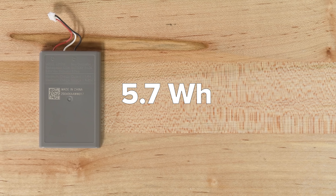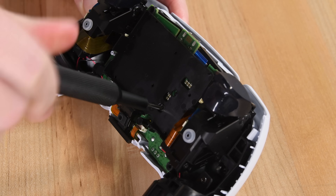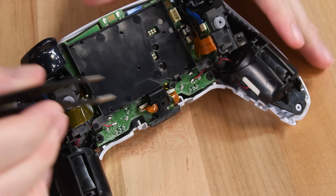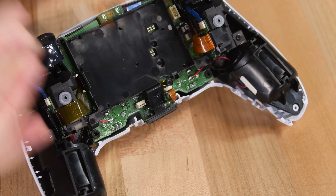This gray monolith is a 5.7Wh lithium-ion battery pack encased in tough plastic. The PS4's DualShock 4 battery pack was also encased in plastic, but it had a much smaller 3.7Wh capacity. The well itself is held down by a single Phillips screw. Attached to the battery well is this little rear-facing microphone — it's easy to disconnect during a teardown, or if you're just nervous about Sony listening in while you're gaming.